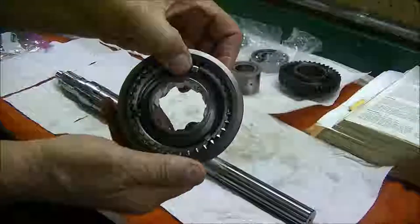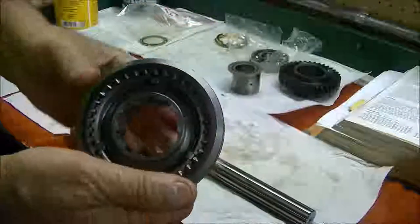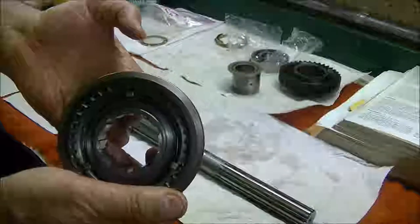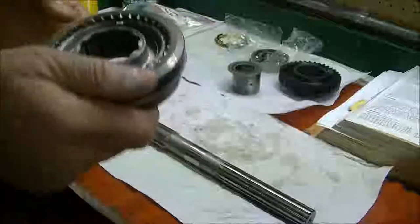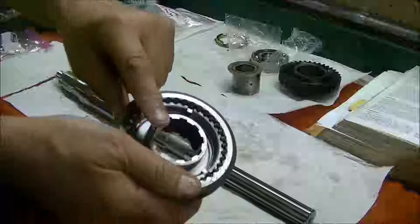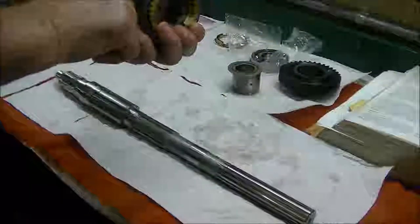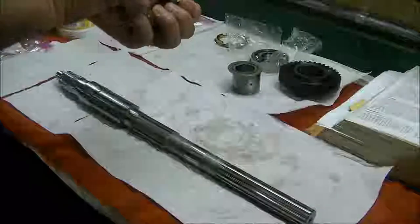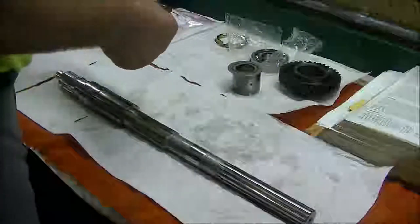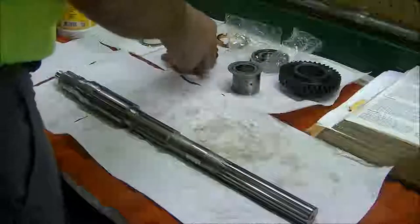One end of the spring needs to be in one of these shifter plates right there. And the other spring needs to be in the same end of that same shifter plate. So make sure you do that. This hub will go towards the front. The taper of the sleeve is to the back. So, first step is to, well, here, let's back up a little bit.